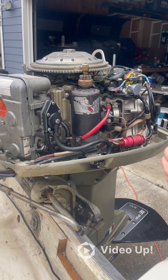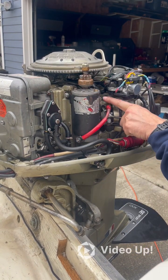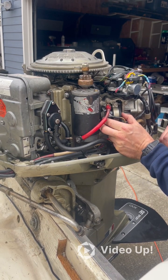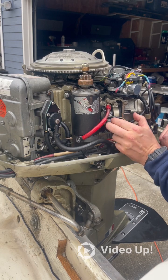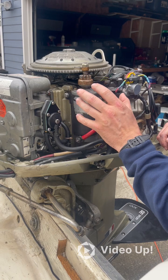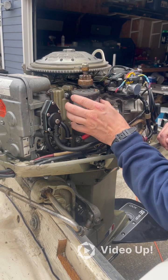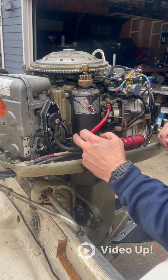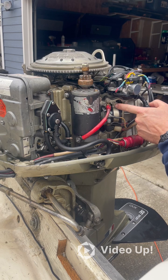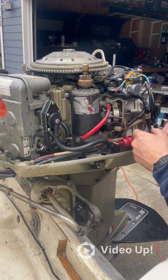To get the starter removed, there are three main bolts that hold it in. You have one up here, one right here, and another one down here that's kind of hidden by your solenoid. So we have to undo the solenoid to get this out. This is your positive battery supply, and the negative terminal is supplied by the ground connection through the actual housing of the starter. We'll undo all three bolts and the solenoid connection, then do a quick swap.